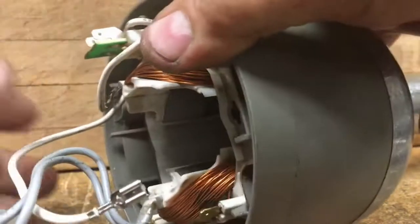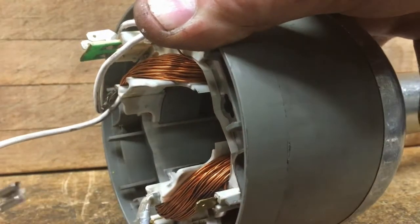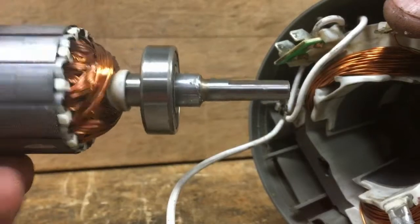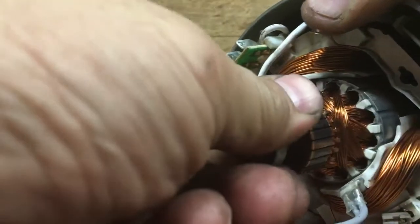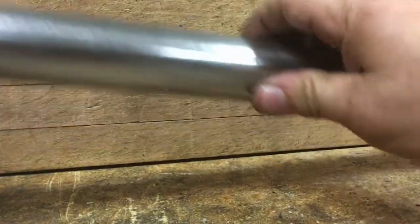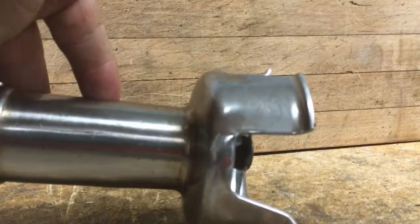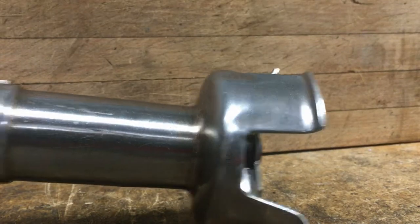Now that we've got the wire pushed in, take that and push it like that, then hold it. We're going to take the commutator — this is the shaft and this is the slotted end — and that's going to go in there. I'm going to turn it until it goes in. As I'm turning it I want to make sure it's engaged, and the way to verify that is to look at the blade end. As we turn it you can see the blade turning — that means it's engaged, so we're good.